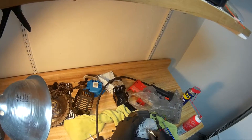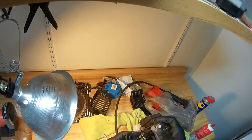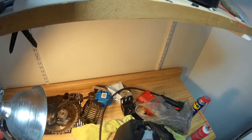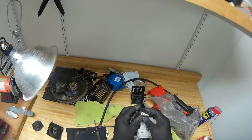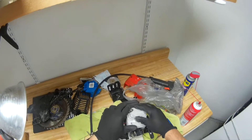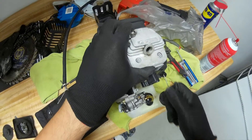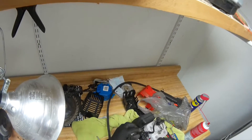So I figured the next step was the ignition system. One simple way to check whether it's the ignition system is that, after we took off the cover, it's to see if there's spark in the spark plug. There's a conductor on the ring of the spark, so you make sure you touch the engine, and then simply pull the starter and see if there's spark. If you look closely, there's some light spark, so obviously it's not something to do with this system.